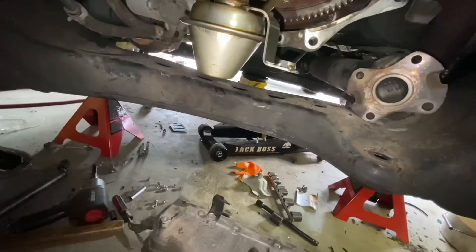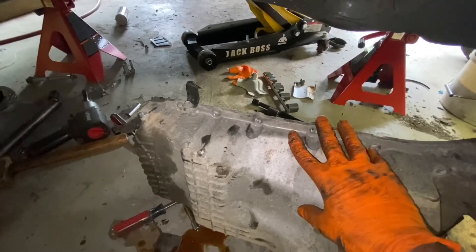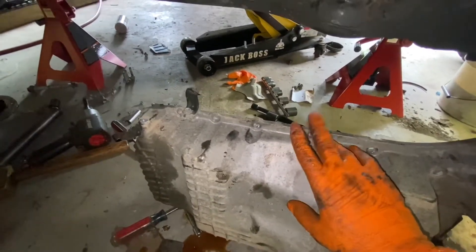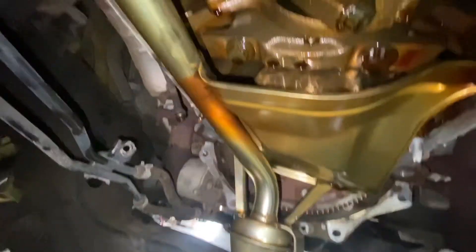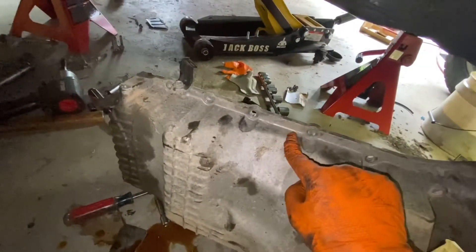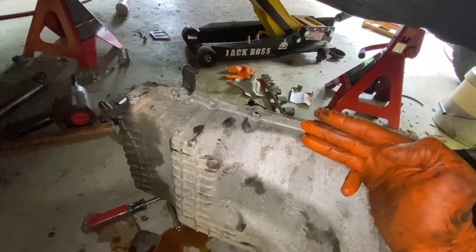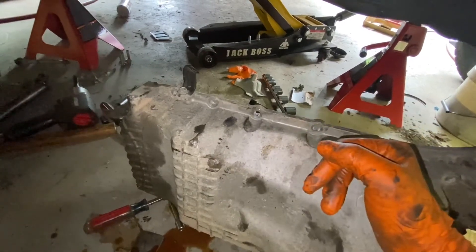So this was successful. There's still stuff that can go wrong, but the purpose of the video is to show you guys that you can in fact remove the lower oil pan to get to the crankcase, rod bearings, all that happy stuff. You can get to all of that — the oil pump — all stuff that can be done with the engine in the truck on a 4.7 liter 2007, '08, or '09 Tundra. They did not put the 4.7 liter in the 2010 and newer. And this truck is four-wheel drive, or at least it was until I did that.